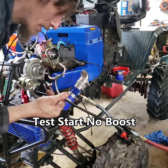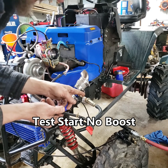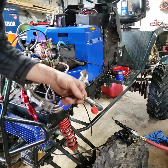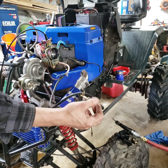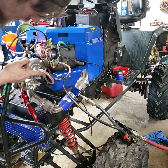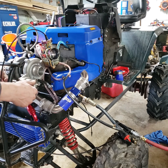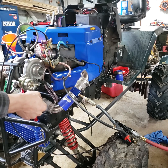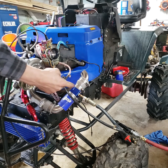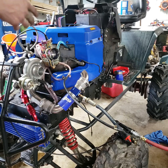We're back with this crazy setup. We have charge pipe feed to the shutoff valve — I added the shutoff valve so I can intentionally turn it on and off without having to keep hooking this up. We also got the overflow now being charged with the additional port on the turbo that is typically run to the diverter valve, which I don't even think we're creating enough boost to move at this point. For testing purposes, I'm going to use this to try to have two boost reference ports off the charge pipe and hopefully keep the pressure inside the carb body the same.